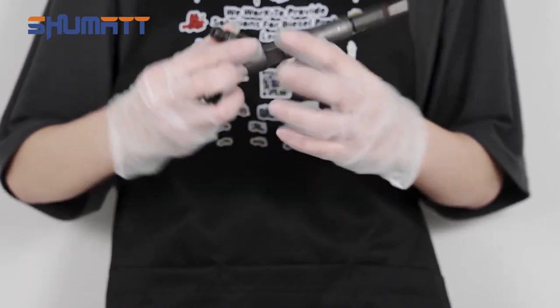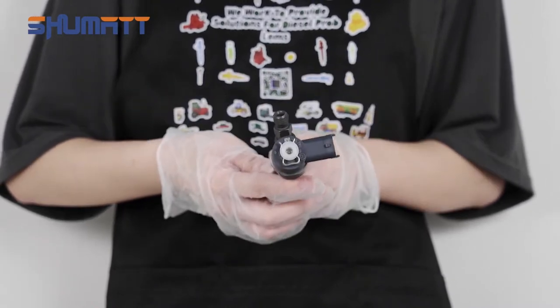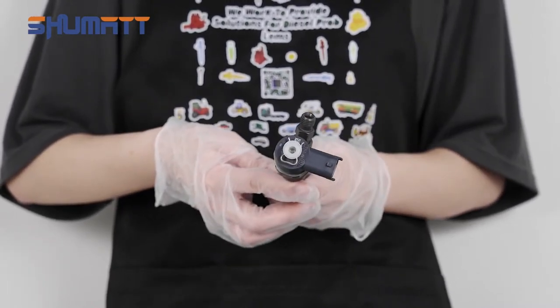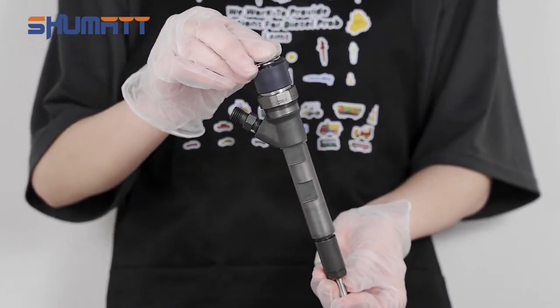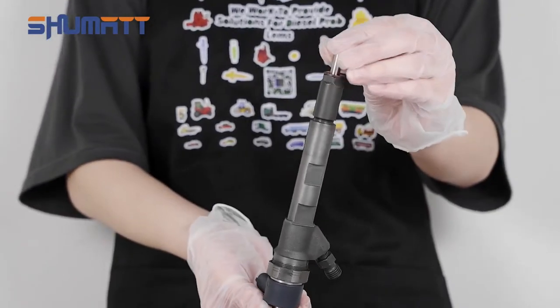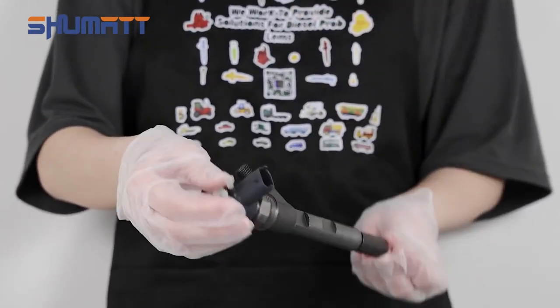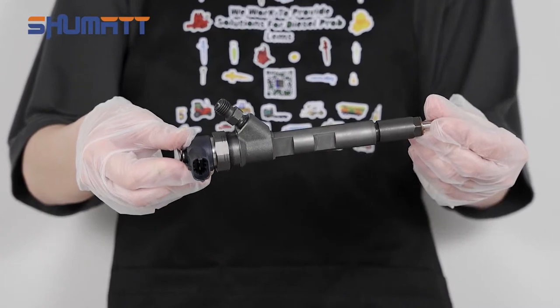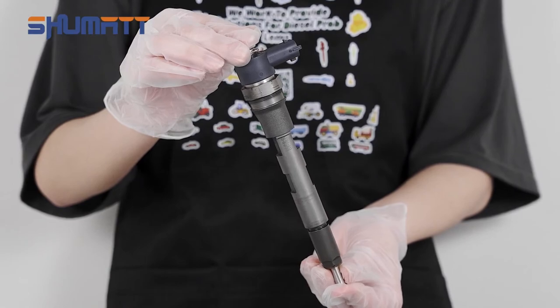The TL means the torque point, the discharge point. Through this test we can measure the amount of oil. If the fuel volume is too small, the acceleration will be slower. And if the volume is too large, then the engine will emit black smoke and cause the emissions to exceed the standard. The LL means the fuel supply at idle speed. And VE means the pre-injection. Here is the test report.